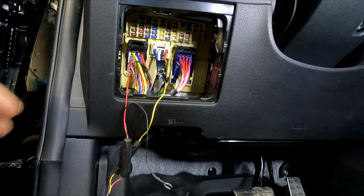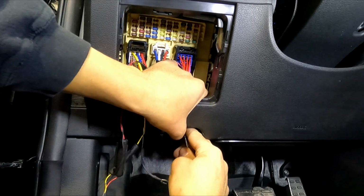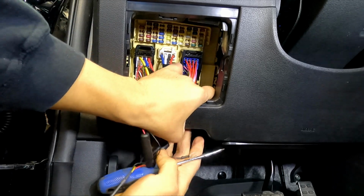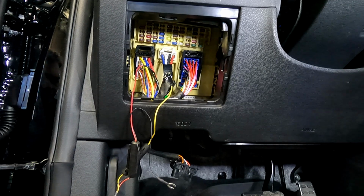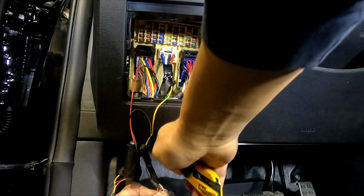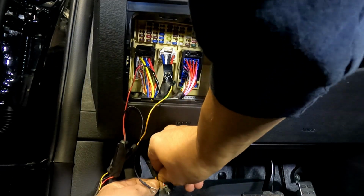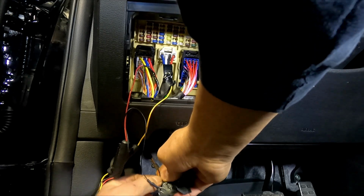Okay, I have this, and our last wire will be our ground wire. So we're gonna take the OBD out in here, access the OBD easier. Okay, so you can see the OBD very accessible in this car. If you've seen my videos before, you know I said that you can also take the power here from pin number 16, which is your constant power. So you can take it also. And pin number 4 is our ground.